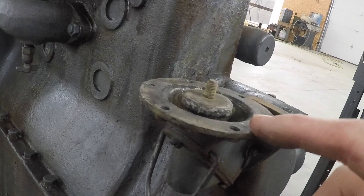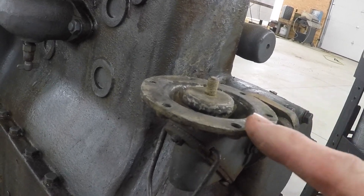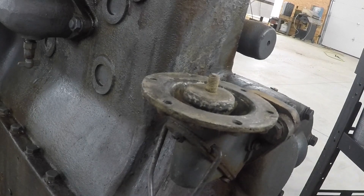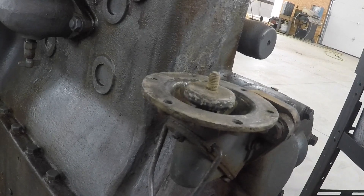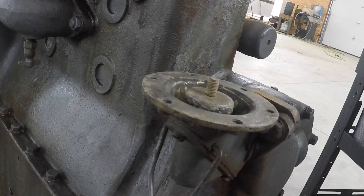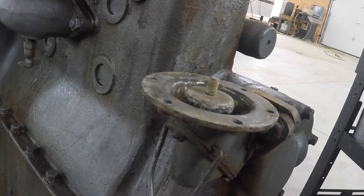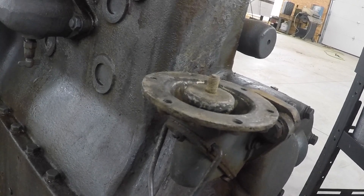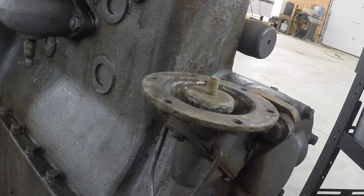Here's a little side view of the pump. It has an eccentric that runs off the cam. I'm going to turn the motor here real quick so you can see that it's going to go up and down to work as a pump, of course. For anyone who's got one of these, it's off the camshaft, so it's every two turns. With the handle straight up is top and bottom center on this thing, in case you're wondering.